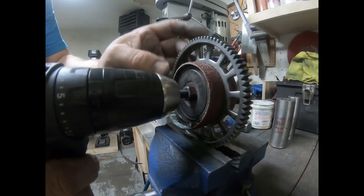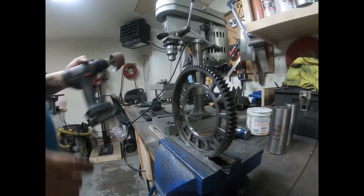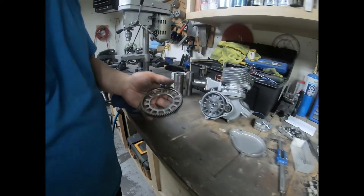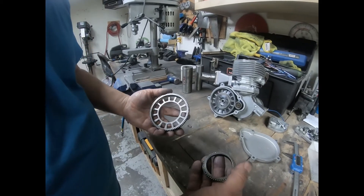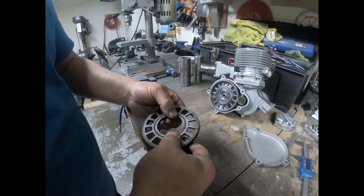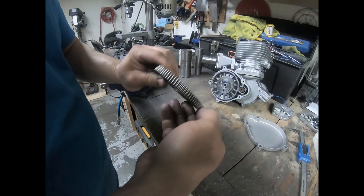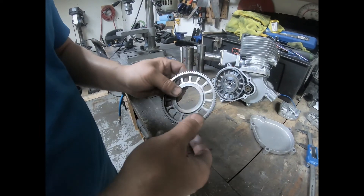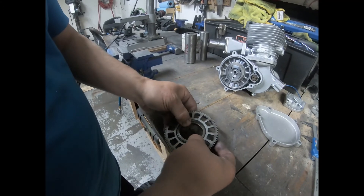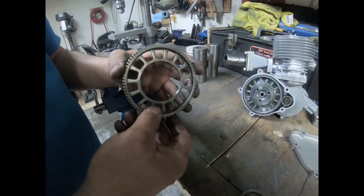Since it's hardened steel, it takes quite a bit to remove material, so you just hone it out a little bit. What you do is hone it a little, then take your 1/8 inch roller balls and test the fit — get it so they're rolling nicely with a snug fit in there again. That'll repair any side play you have as well. So that's a little tip to fix up your basket and replace the bearings with a larger 1/8 inch roller bearing. Don't forget to subscribe, like, and share.